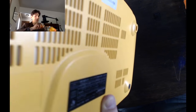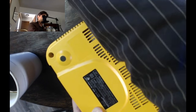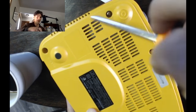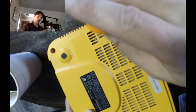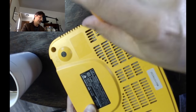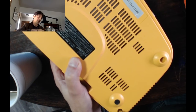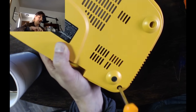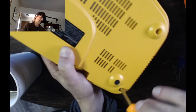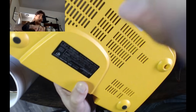If you don't know the rule of tightening: see how I'm tightening this screw and then this screw? That is because I want things to go in evenly. Don't start screwing everything together on one side and then go across — it can cause fitting problems and cracking. Go opposite corners; it's way easier. That's actually a life lesson — most things tighten better that way, so just get into that habit. Used to really be a problem with really old computer frames, but now everything snaps together.